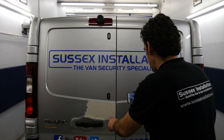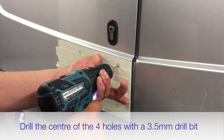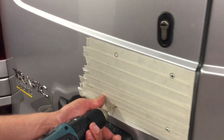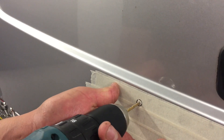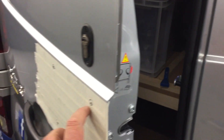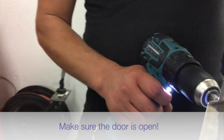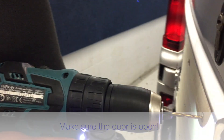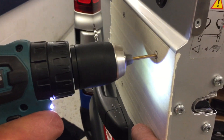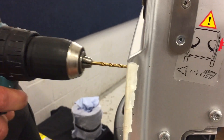You're going to drill the middle of the holes which you've marked on the outside. These two holes on the edge need to go through to the other side as well, so we need to make another hole on the inside of the vehicle. Make sure you hold the drill straight against the bodywork and follow it through until you see it come out the other side.